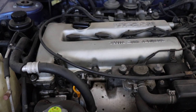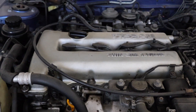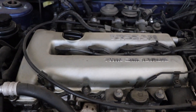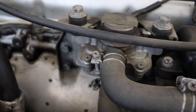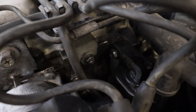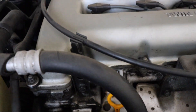Now when you're dealing with a car with wet, leaky oil underneath, try to find the source. Don't always start at the oil pan or something like that, because oil leaks seldom travel up the engine block. I want to show you something here — you come down and you can see oil just south of the valve cover. That's your sign. And it's not just in the front — it's going down the side. There's residue where it kind of sprays up there. You come around the rear of the block and it's the same deal back there. So we have a really bad valve cover gasket here.